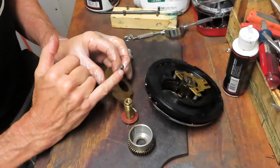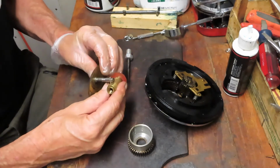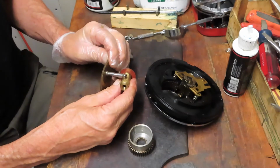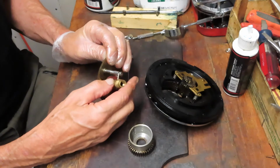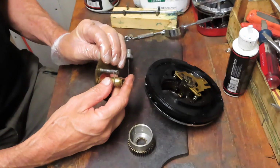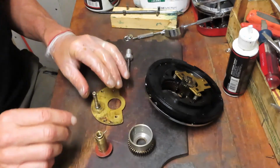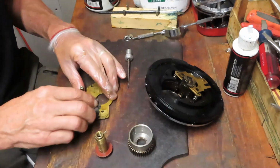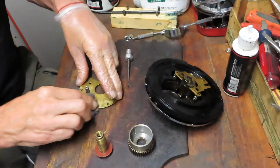And you'll notice on that bridge post you have a slot, and that slot, that's what controls or holds on that sleeve. It's going to go through, it's going to ride in. Now, of course it's going to ride in like this, but that's where it rides. That's why this won't fall off when you go to reinstall. All right, I'm just going to clean up the dried grease on the bridge post then, or the bridge plate itself.